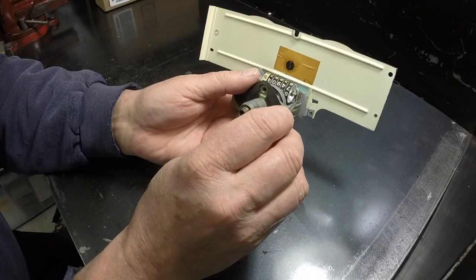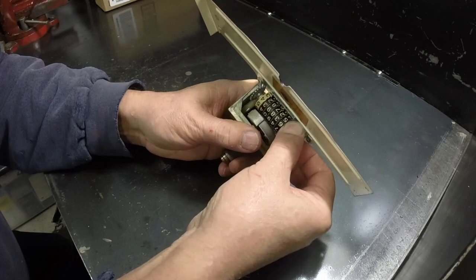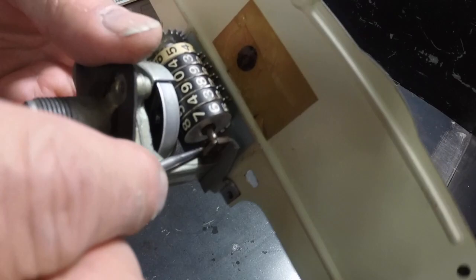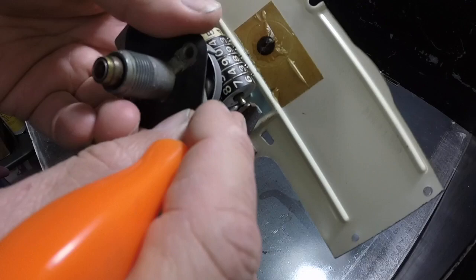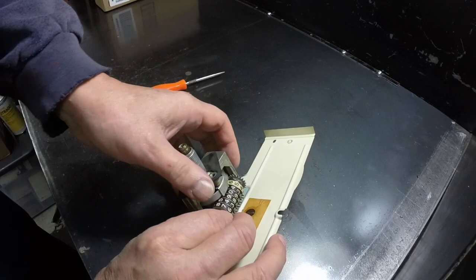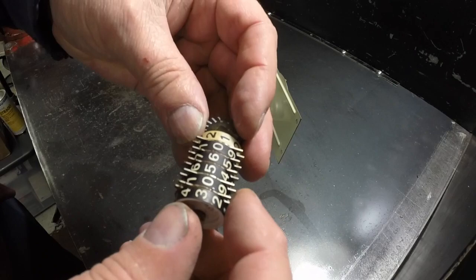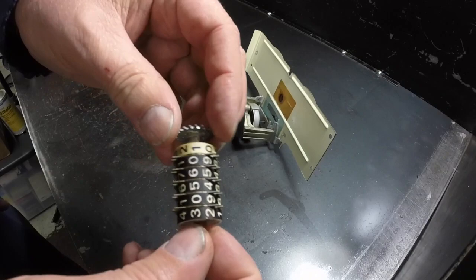This little clip pops off, but these little things are clipped in underneath on this side right here - they're kind of a pain to get off if you're not careful, plus this is all rusty. See that little clip right there, you've got to get that off. See how they hook right there, and there's a second one right there. So they can be a little bit of a challenge to get those out, then push this up and the clip's off, and then your odometer's out. See how it has these little things? That's what holds it in to that bar to keep it from rotating around.